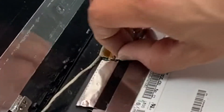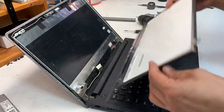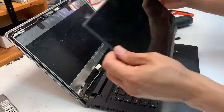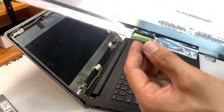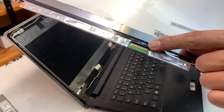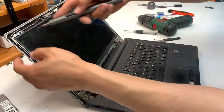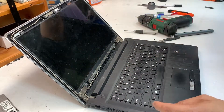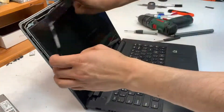Lift up the tape and don't lift it straight up — lift it away from yourself. Be very careful when putting it back together: make sure you align the cable properly and then push it in, because if you damage any pins on that cable, you're done.